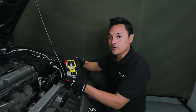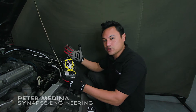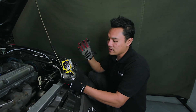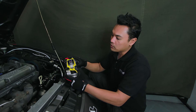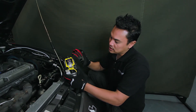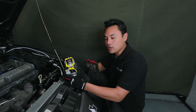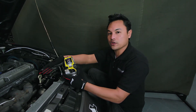The synchronic wastegate is different in that it doesn't have a diaphragm, but you can also treat it like your traditional wastegate — you choose a port on the bottom to open it and a port on the top to close it. You can use it with any other boost controller you'd use with a normal wastegate. But what's done differently is you can actually change your boost pressure for up to six different settings without ever having to buy a boost controller, and that's what we're going to show you on this engine.